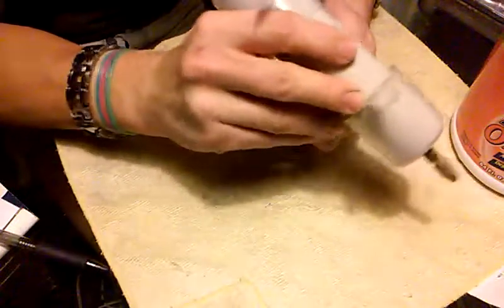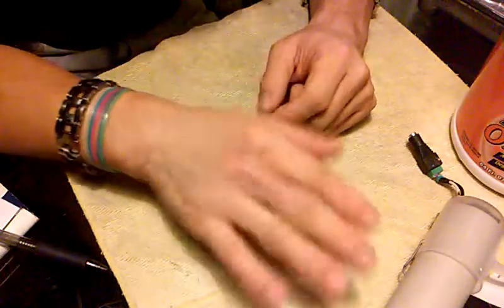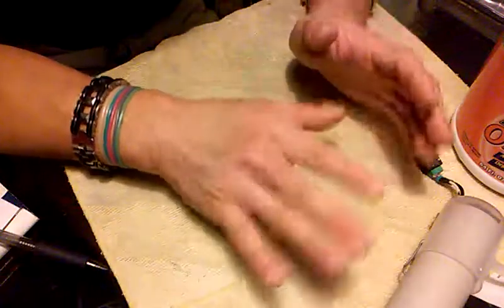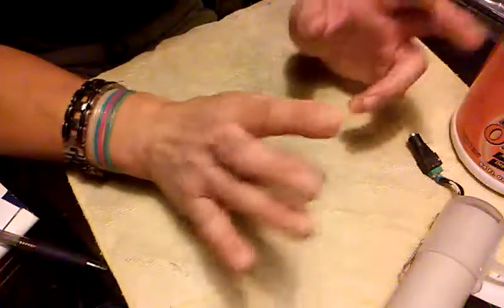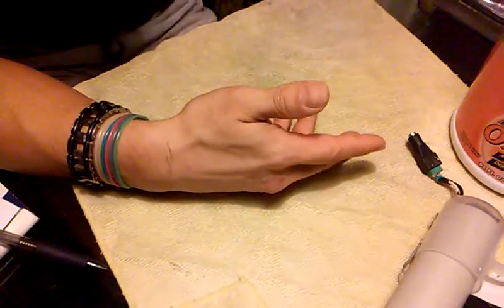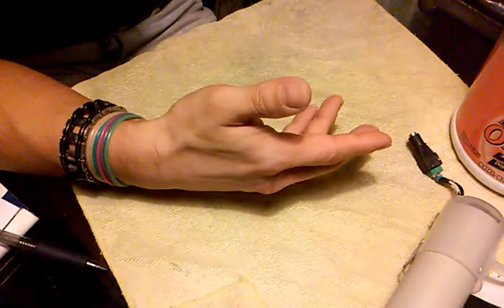But a metal brush is extremely abrasive. This stuff is very, very light. You can get into little crevices with that, and it'll just strip the rust right off. That's a very time consuming method. It's not something that you want to be doing all day, it's a pain in the ass. So my recommendation is to soak it in hot solution, 24 to 48 hours.